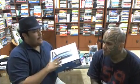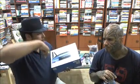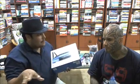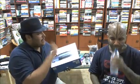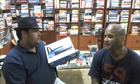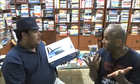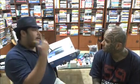Next, it's also an access point. An access point means I don't need to be connected to the internet — if I have a network within my house to connect multiple devices, this will be my access point. If every device is connected to this, whether by wire or wireless, I have access to all of them. This becomes a junction — if I have five or six computers in the house, it connects all of them, wireless or wired. You can have up to four wired devices and up to 40 or 50 wireless devices.